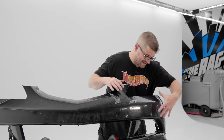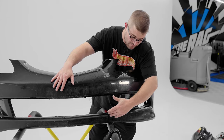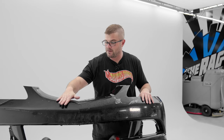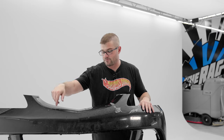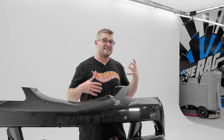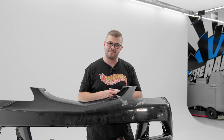I'm hoping I can get some of this out of here because I think it's gonna be the biggest pain on the lowers because that's gonna be the most chipped area where I think that the film's gonna be really fragile, but up here as well because of the sun exposure here with the heat and all the cracking that's already formed in the PPF already. So we're gonna keep at this. I think this is the right method so far. I might attempt a heat gun in one section to see if that helps a little bit, but I really think steam is probably gonna be the answer.